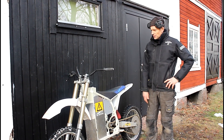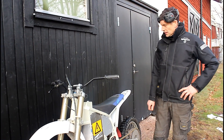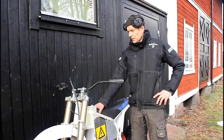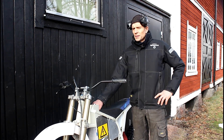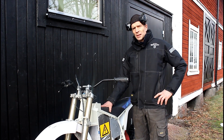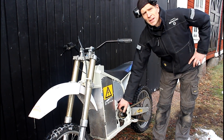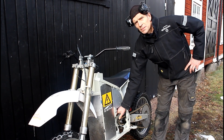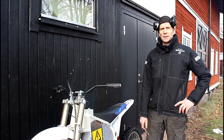I rebuilt the chassis to fit the motor. It's 72 volts and the battery pack can produce 400 amps for a few short seconds, giving about 28 kilowatts — which is the same as the Agni 95 motor can handle. So about 28 kilowatts for some seconds, which is about like a 250 dirt bike.